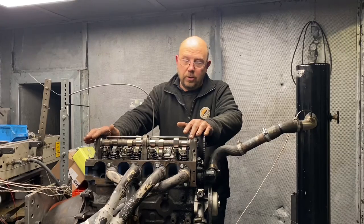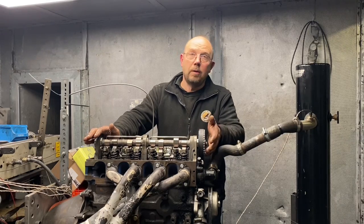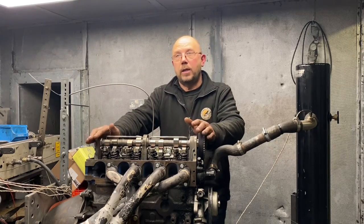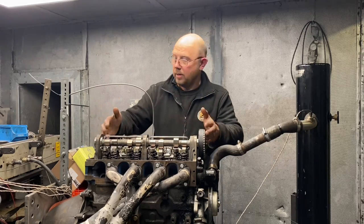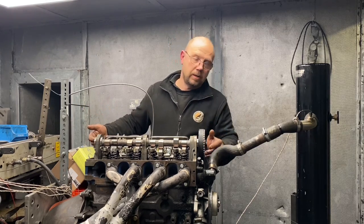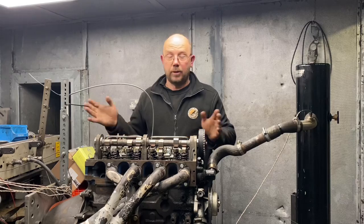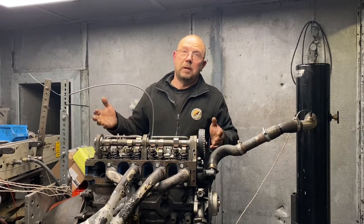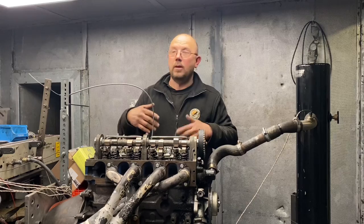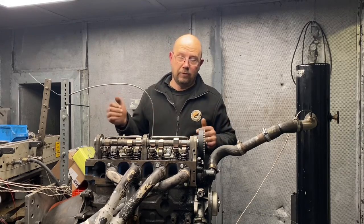While it's on here what I should do is optimize the cam timing by the vernier, and then when it's done and he's ready, he can just take the whole cylinder head, plonk it on his engine, drop the belt on as if it's standard — not having to worry about vernier degree wheels and timing the cam. Because if the cam's right on this bottom end and his has never been skimmed, it's going to be very very close to where it needs to be.